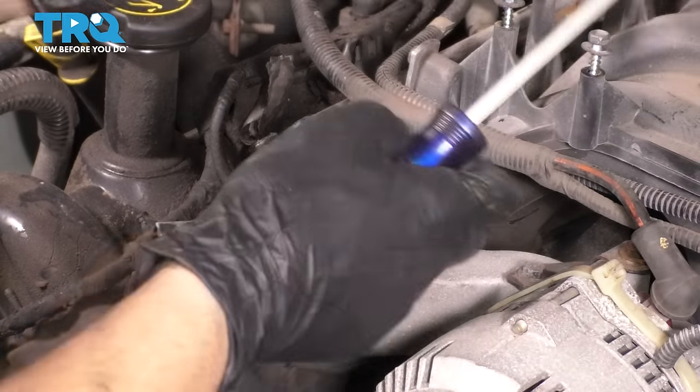There's a screw here that secures this bracket to the intake. I'm gonna start by tightening this one. And now let's tighten up this one in the back here. Okay, that's secured. Let's plug this in here. Plug in the sensor. Now let's reconnect this bracket for the throttle cables. Had three screws that mounted it to the intake.